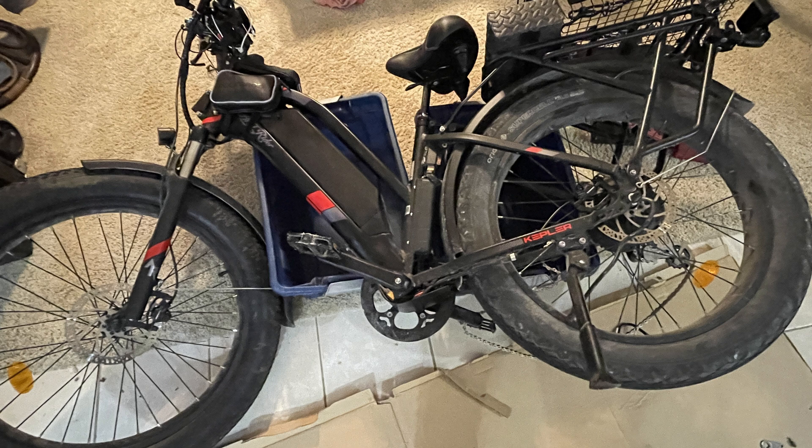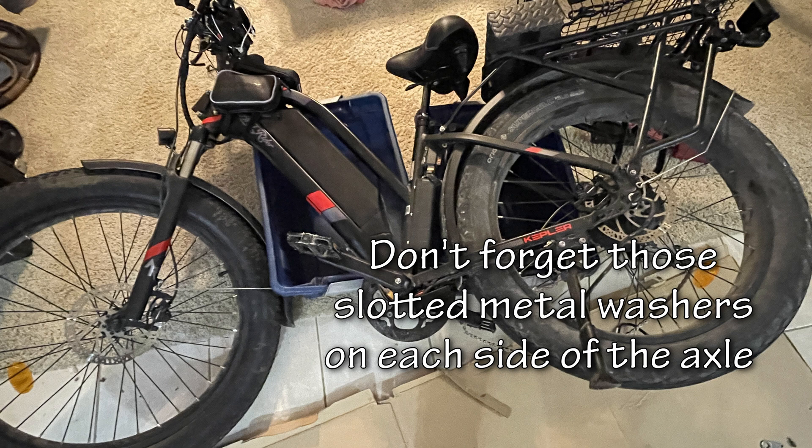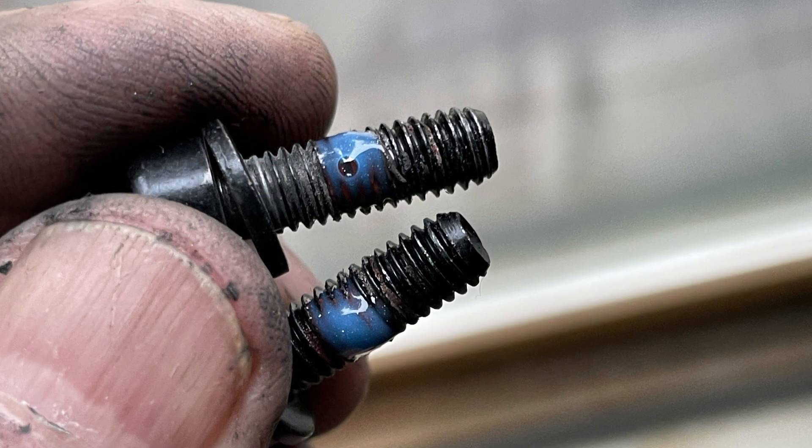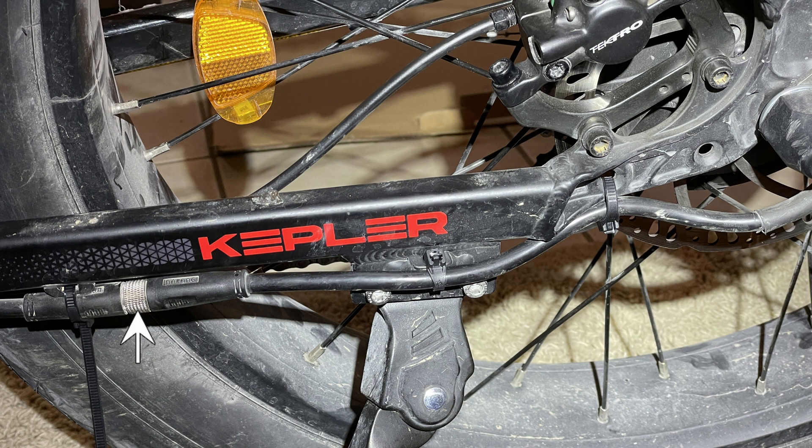Then it was time to put the wheel back on the bike, which for me was about more trouble than anything. After struggling with it a bit on the side, I ended up putting the bike upside down with the handlebars on the plastic bin, and that made it easier to put the wheel in. It's always a bit awkward getting it past the derailleur and into the brake pad caliper, so I took off the brake pad caliper and replaced it after the wheel was on. This caliper had been recently removed without Loctite on the bolts, so I put a little dab on this time. It doesn't take much Loctite. Screw the motor cable together securely and remember to replace the cable ties.